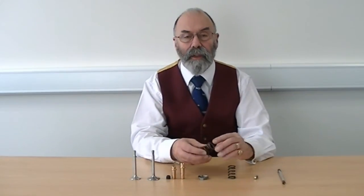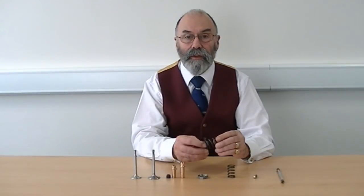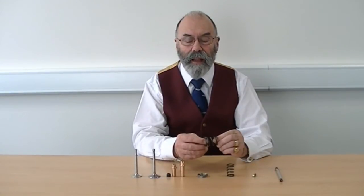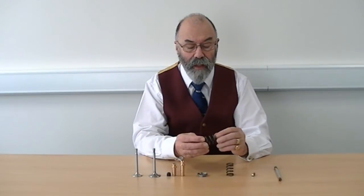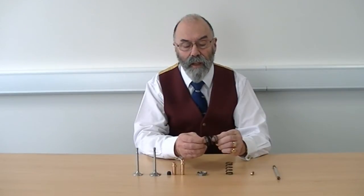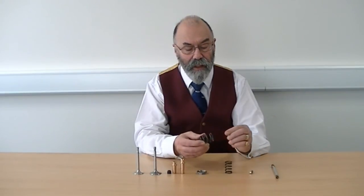These are our valve springs. When I was in the Triumph race team, we used the famous American S&W springs. They needed the head machining back to give the right free length. When I designed these springs, I made sure we had half a coil less wire so that they could cope with the higher lifts without machining the cylinder head.